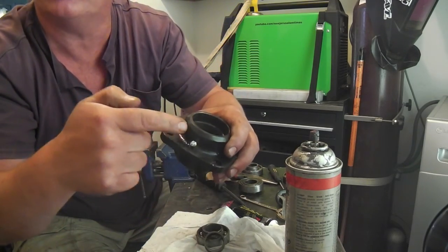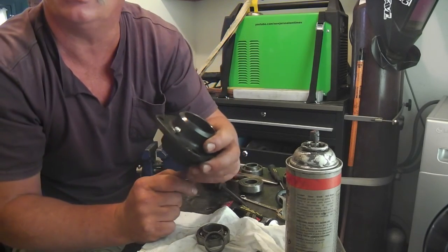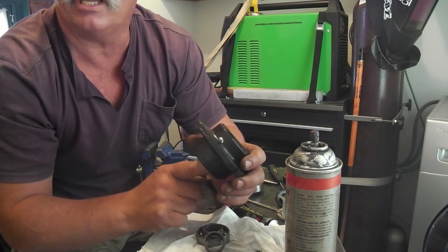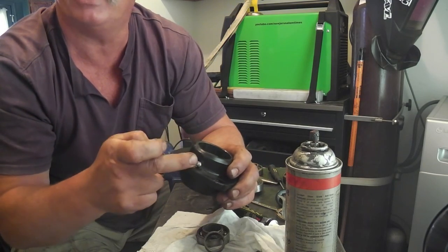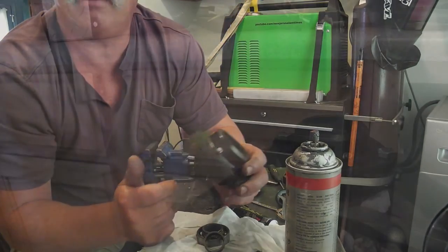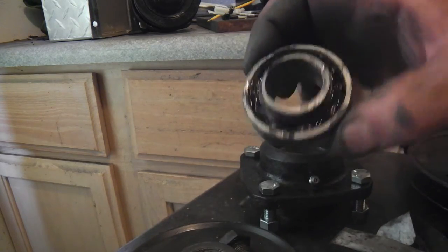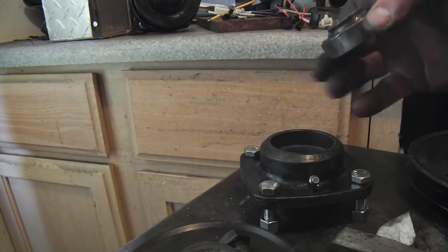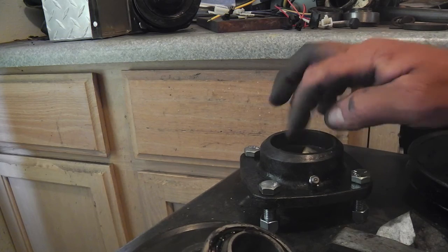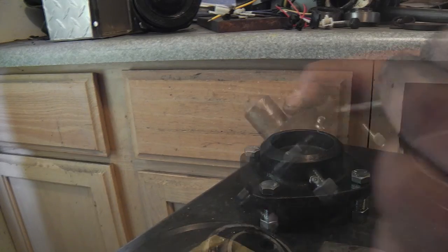What we're going to be doing is going to be better than just allowing moisture. I think it was clogged anyway, because it had grease and other things in there, and it's not really as effective as this. This will be pushing grease in, moisture out, so it's going to be altogether that much better. So here we are getting ready to pack one of these, and I've already pre-packed the bearing itself, and the other one's installed. This one will go on top, but before that happens, this little spacer gets dropped down in between them. I don't know if that's really that necessary, but it's going in.